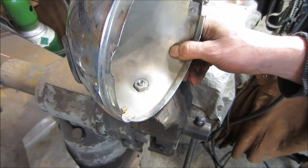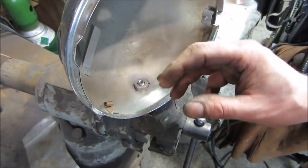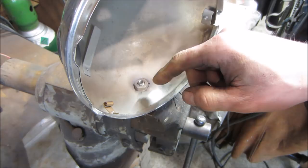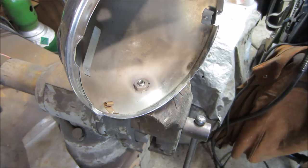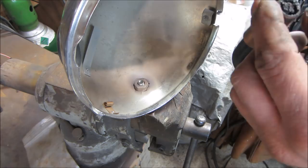I'm seeing where it tore out and just trying to make those two pieces meet even. I'll get a tack on that, look at it, and if I need to flex or move it a little it'll stay at that point, then try to buzz all the way around. It may just melt right away — I don't know. I've got the welder turned down to roughly 18 gauge. Need to clean the tip first.